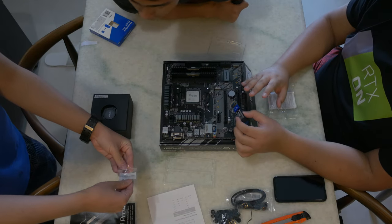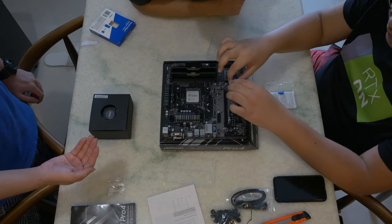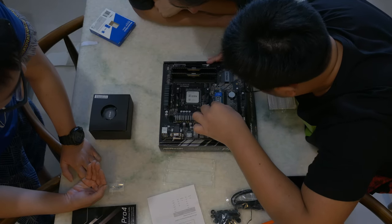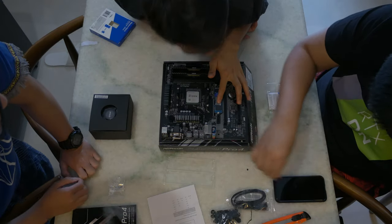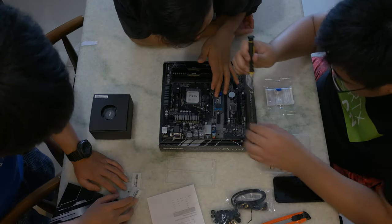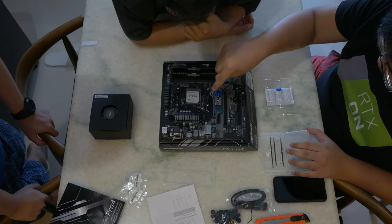This is one of the easiest SSDs to mount because there are no cables. Normal SATA SSDs are quite big and bulky — you have one cable for data, one for power, and you need to manage that. But this one is a card and it just slips in. It's a bit tight — do we need to apply extra force? I'll need a magnetic screwdriver because I've lost a couple of screws in my life. Our SSD is done, our RAM is done.